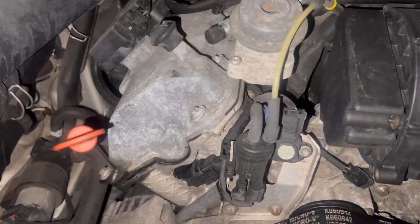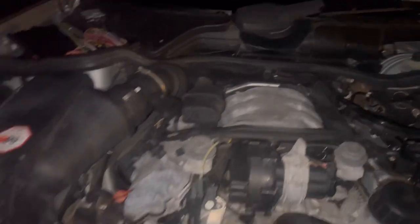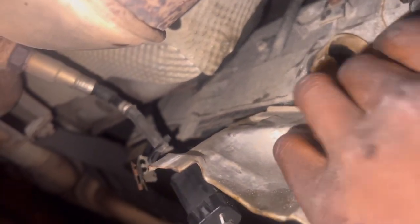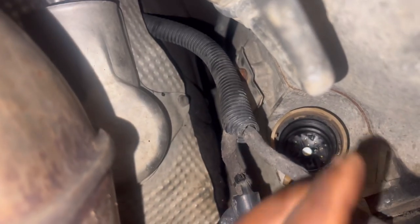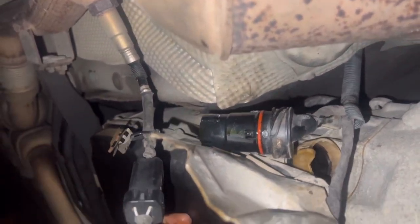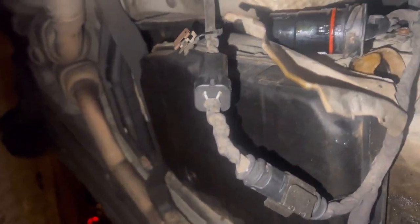Things happen. I can still make videos. Also, look at my belt — the belt's going too. Alright guys, we'll take that out. I'm going to replace this connector right here. It's a 7mm bolt right there that I need to take out and pull this thing out, and we just go from there. Make sure your transmission is not hot — before you pull that, make sure it's cold. Mine is pretty cold, I haven't been running it. So let's get to it. I've got a 7mm and I'll remove it.